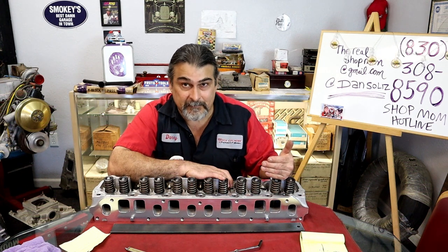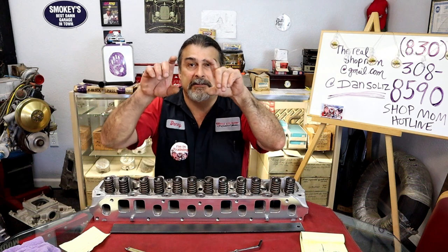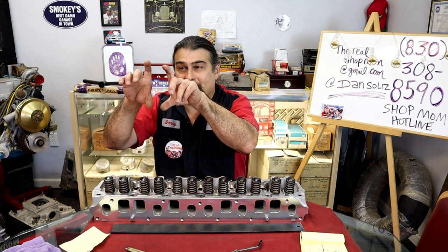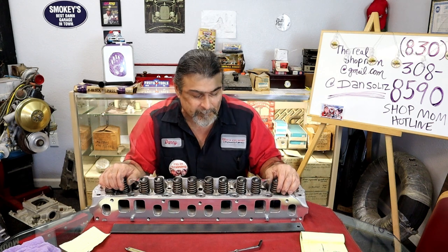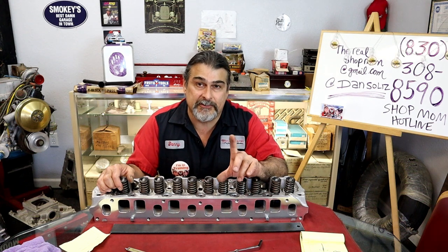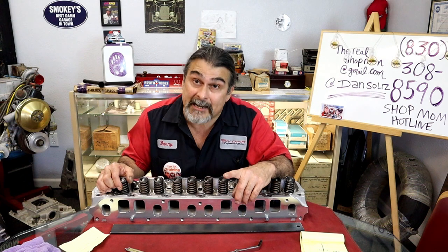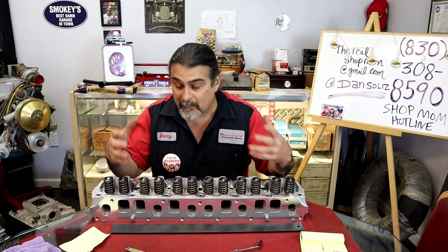It's unbelievable. Until you put it on a dynamometer and check it yourself, and all he does is change the length of a push rod, just like we're messing with the lengths of the valves. So he decides to change a lifter push rod length, and then he does a valve adjustment, the same thing that a hydraulic lifter is going to do. It's going to self-adjust. By changing the push rod length, he was able to change the valve lift quite a bit. It's a great video, go watch. Pause this video, go watch Ralph Johnson's video, and then come back and go, damn. Because the more you learn, the more you go, damn. We didn't know it was so complicated.